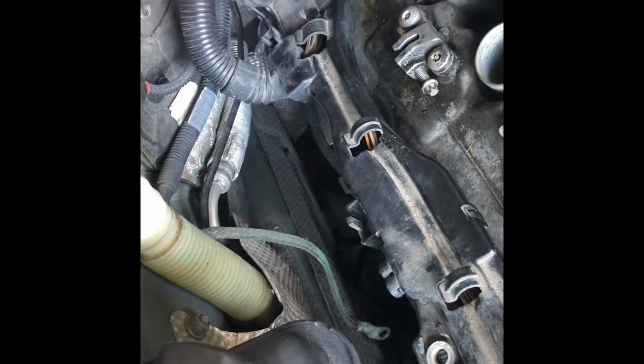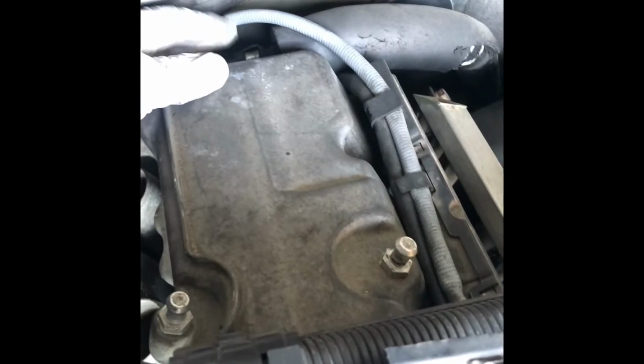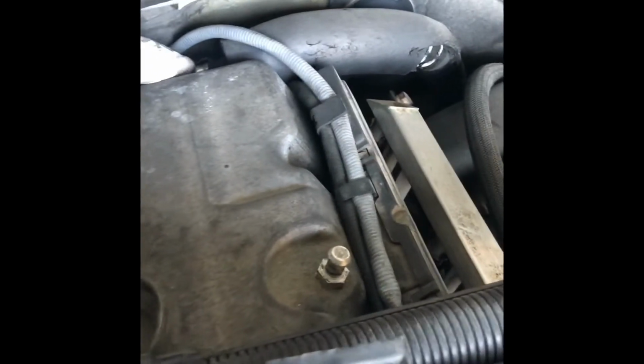I could tuck it down, and there's a clip that holds this harness over there. You just pry it out with a pick, and then this whole part will move out. So it's time to take out this hose. It's the heated CCV. If you just press on it, and I think I broke this one already. I think I did remove this before. Yeah, it's gonna be a struggle. Oh, it's not that bad. Yep. So I have it out now. Okay, so good.